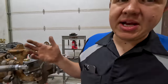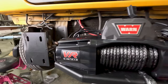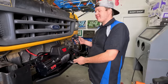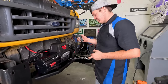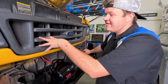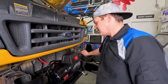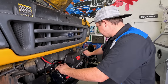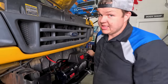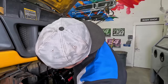We've just about got this axle all done. I want to show you the Warn winch we just installed on the front and got wired in. We went ahead and got this installed on our Barnes 4WD mount plate — this is a Warn Industries VR-12S synthetic-lined 12,000-pound winch. We got it all wired in and it works pretty dang good. On these buses, the batteries are actually in the back, so we wired it up into the starter solenoid and a ground post that runs back to the battery. Now we just got to put the bumper on, and we'll have the front end of this bus done — other than fish plating the outside of the frame, but not today.